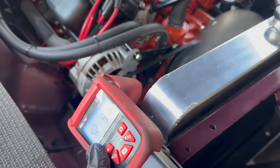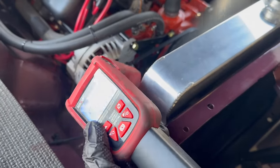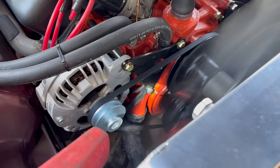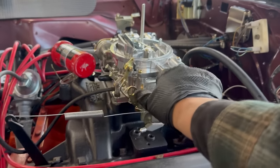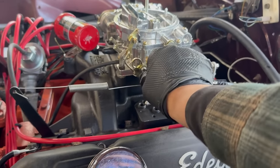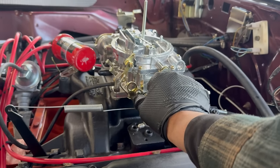Something might happen. I had to give the idle screw a tiny bump. Now we're right around 950 to 980 RPM idle. And the idle timing is 42. Now what's 1 degree among friends, you know? It sounds like it wants to party.